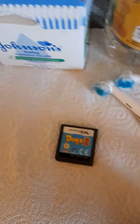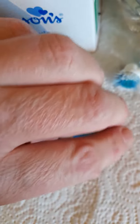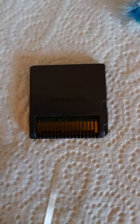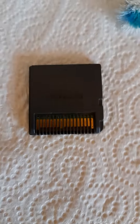If that doesn't work, try the vinegar again, and this time use a small pin. Brush some vinegar on first and then use the pin to give each connector a good clean individually, scraping off dirt and corrosion that can be embedded into the connectors. I did try this with some games I bought recently and it worked.